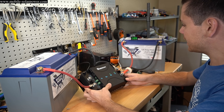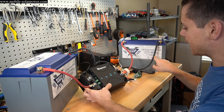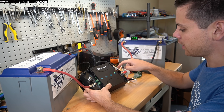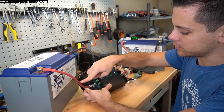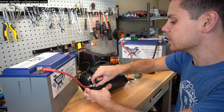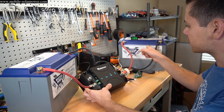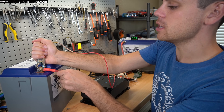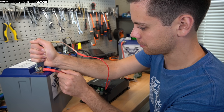Now it's completely connected. We have a positive wire from the solar battery, a negative going to the common negative, a negative going to the starting battery, and a positive going to the alternator positive. All we need to do is add voltage on the starting battery side and it will start pushing power over to the solar battery. I don't actually know what state of charge these batteries are at, so we might be in for a surprise.